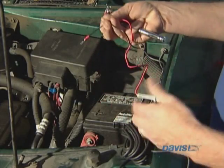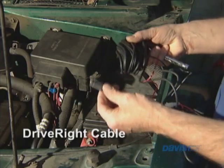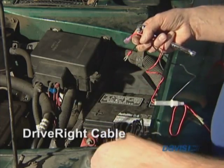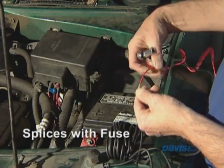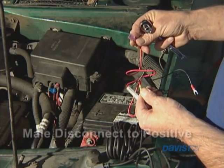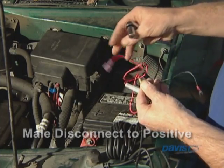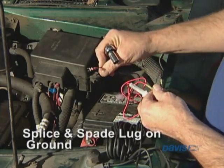What I've done is I've dressed the cable. I've taken the drive-right cable, which you see here, with the connector on the very end, and I've dressed it a bit. Essentially I've added the butt splices to put the inline fuse in. I've added the male disconnect so we can connect up to the positive, and I've added a butt splice on the ground and added a spade lug here.